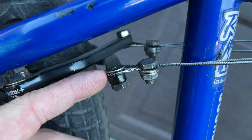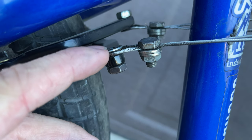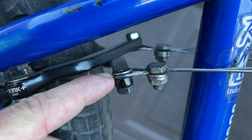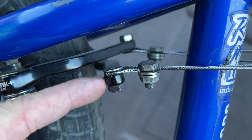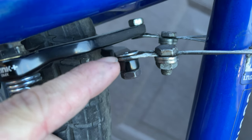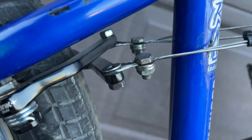I was setting these brakes up in a live stream on YouTube, and Kurt Rowell suggested in the live chat that I should just put a bolt through the hole in the brake arm. That's when the light bulb went off — I realized the brake mount bolt from my old brakes is tapered at the top, and if I put it in and put a nut on the bottom, that tapered part would help keep my cable loop locked in there. And that is exactly what it does.